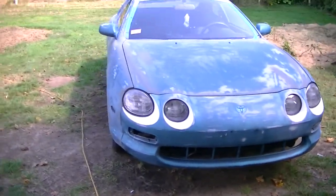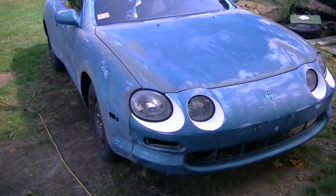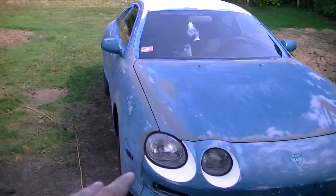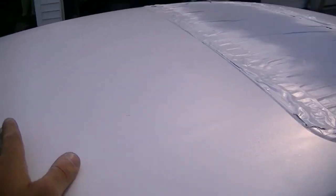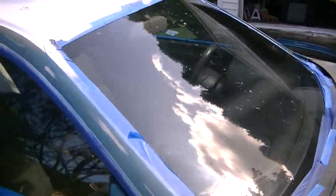So the car has been reassembled - not for the final time, just to get it to paint. I'm still going to sand down the whole car again by hand, but I just have to go to work right now. You can kind of see the style I'm going for here with the white roof and the white eyelids. The roof came out alright - as you can see there's like a glare from the clear coat. This is why I hate using clear coat from a can, because it always leaves streak marks. I'm going to try using the buffer and polish, buff it out a little bit. I got all the overspray off the windows and the windshield.